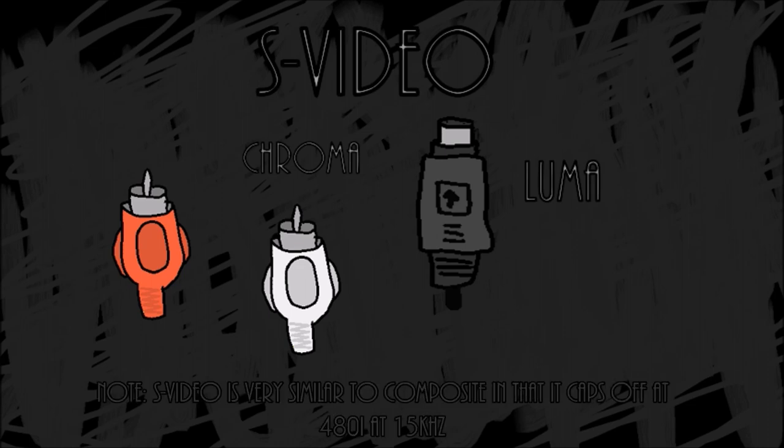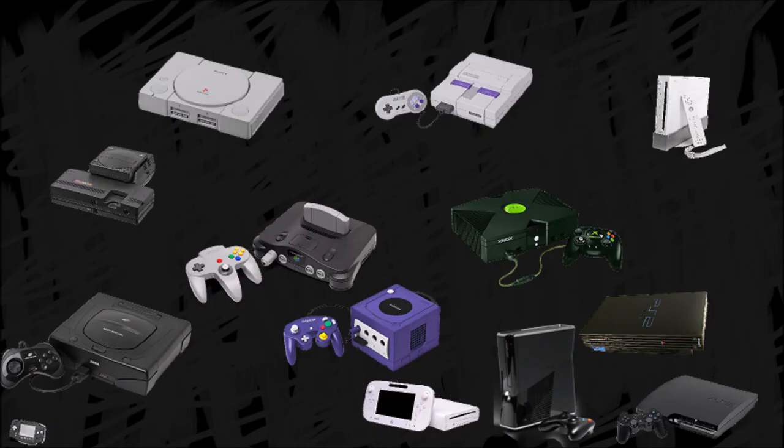This way, a cleaner image can be generated. In my opinion, the leap from composite to S-Video is huge, and considering the amount of consoles that support it, I love to take advantage of it whenever I can if it's the best or cheapest option on a console. S-Video is supported by the Super Nintendo, the Sega Saturn, the Sony PlayStation, the Nintendo 64, the GameCube, the Xbox, the PlayStation 2, the Nintendo Wii, and, again, some HDMI systems that have the previous console's AV outputs.